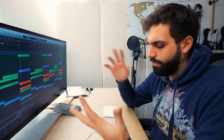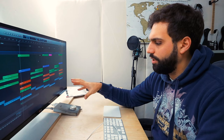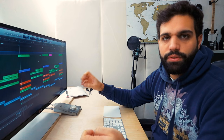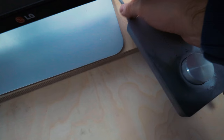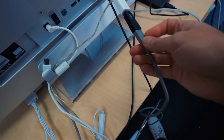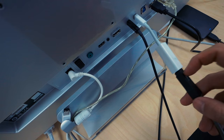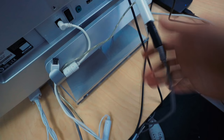I opened Logic, pressed play and the sound card is not working. Usually it immediately turns on — it's bus powered, connected to the screen, and the screen via Thunderbolt to my MacBook. I really don't know. I'll first check all of the connections, because there are a lot of them. The sound card to the Firewire 400 connection, and the Firewire 400 to Firewire 800 adapter connection — all good. Then the Firewire to Thunderbolt connection to the display and to the MacBook — also okay.